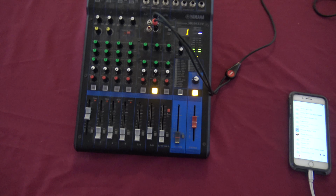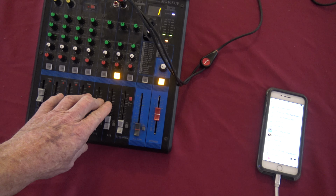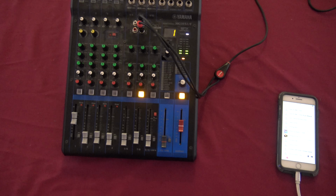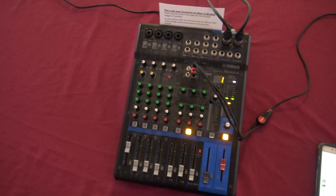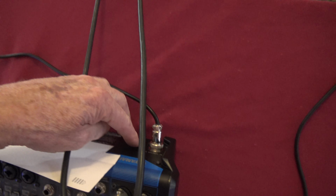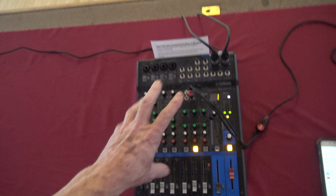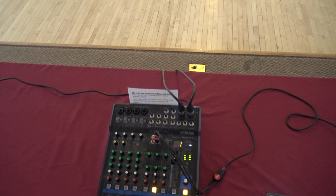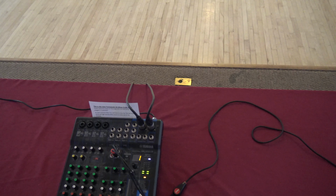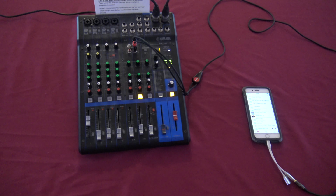And when you turn all this stuff off, normally you would turn off your sound first, whatever your computer is. Go over, turn off the amp rack, then go to the back of this and turn it off there. If you turn this off right now with the amps on, it will pop through the speakers, and that's not good. So that's a little short tutorial.